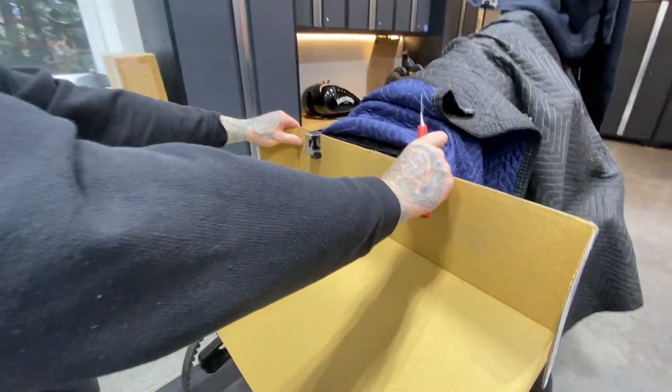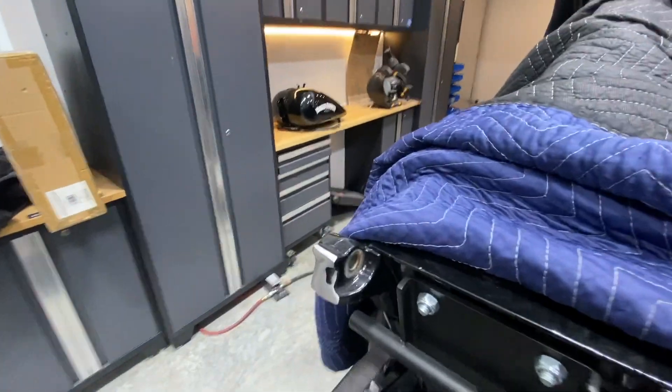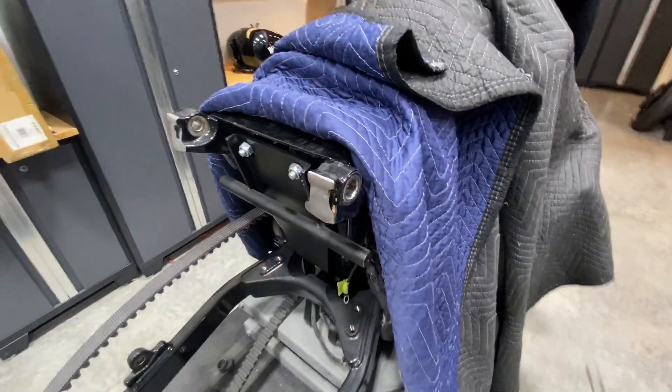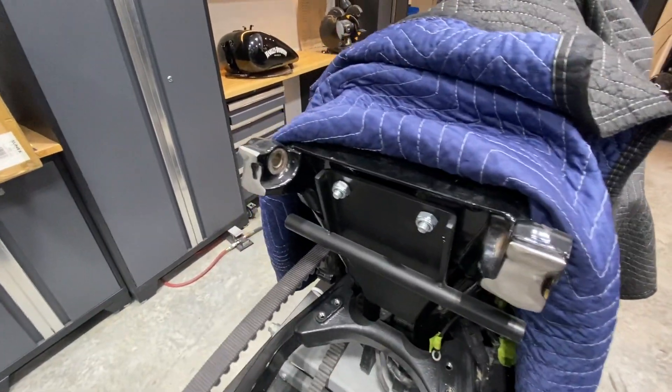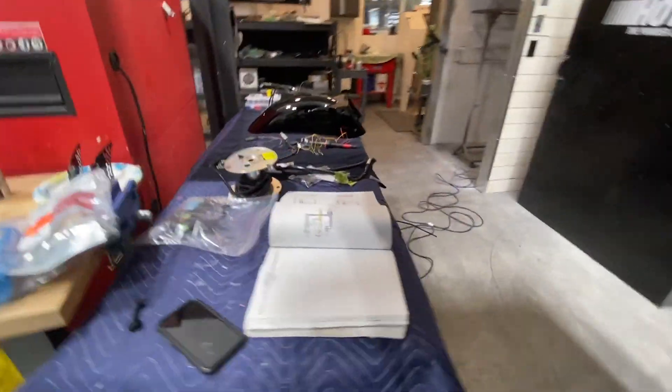Here's Jai. He's just going to be painting the frame — the struts that we cut off. He's going to be painting them with some high build primer and some black, just enough to seal them off so they don't rust. They're all going to be completely covered by the fender so you won't see it.